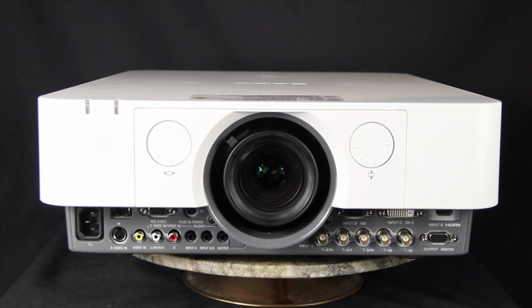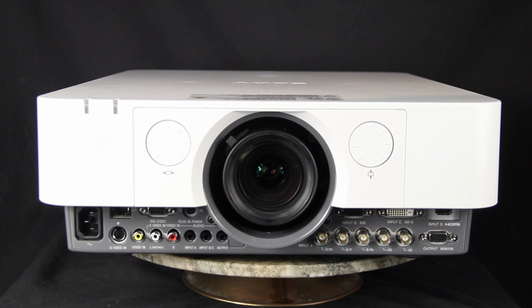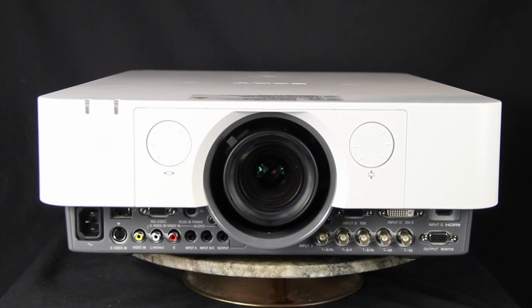It's tour time for the Sony VPL-HZ55 projector. We will of course start in the front, and in this case that's where almost all the action is. Right in dead center is the 1.6:1 manual zoom lens, and to the left and right of it respectively are horizontal and vertical lens shift. 2 power indicators over here on the left and right below the front infrared sensor. The only thing on the back is a rear infrared sensor.